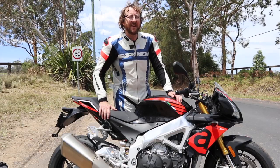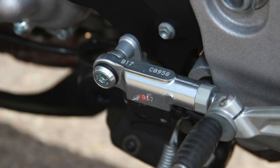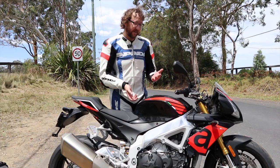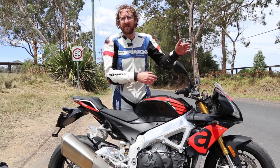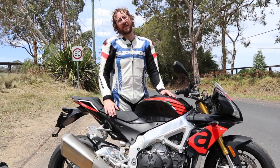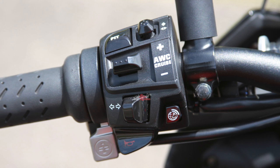The up-and-down quick shifter shifts down beautifully and never misses a shift on the way down. Upshifting has been a little hit and miss — first to second works okay but there's a long delay and the bike bangs into gear. Second to third is pretty smooth, but I keep missing third to fourth and have to shut the throttle to get it back in gear, which sends you slightly off line. When riding aggressively at high RPM with load in the gearbox, the quick shifter works quite well.